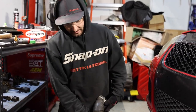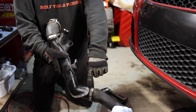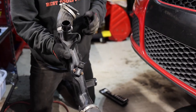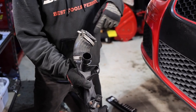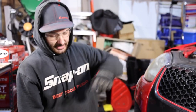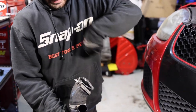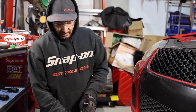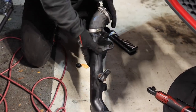So as you can see, we got this whole piece out. We took it out as one complete assembly. Of course, you could disconnect the little hose clamps and do it piece by piece, but why not just take the whole thing out together? So I had Wes off camera. He had to go up top, and where this connects to the throttle body, I had him put a screwdriver in there and just kind of break the seal, and that was able to slide the whole thing out through the bottom. We are going to reuse this sensor right here,